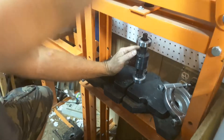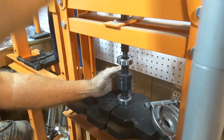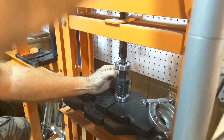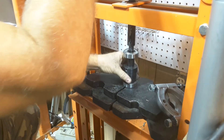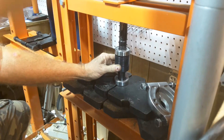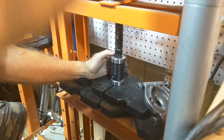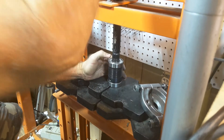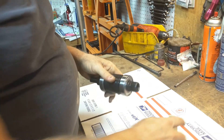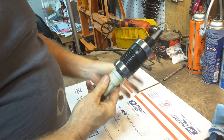This is a different bearing press that I used for this one, but again it's 12-ton — just a more stable press. You can see how much friction was involved and how much work it was for the press. Now I'm just going to put the drive ring back on in place to make sure it's not twisting. And there are brand new bearings installed on the drive sleeve.